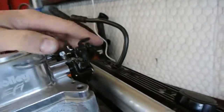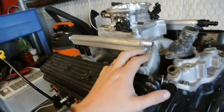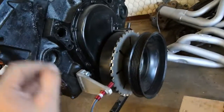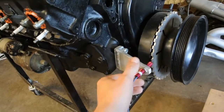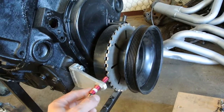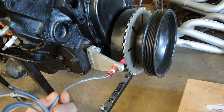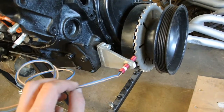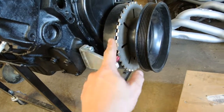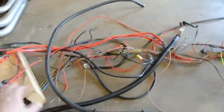I made this spacer to get around some of the throttle linkage stuff, and that's working out pretty well. To get a crank signal I made this little bracket here, and you can get this tooth wheel from DIY Autotune. This is a Cherry Hall sensor — the same sensor I use for wheel speed in the front and rear for traction control and miles per hour in the 240 — and you can just have it pick up your crank signal here.